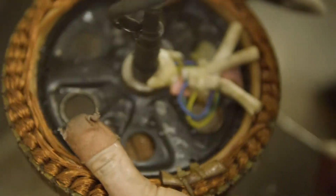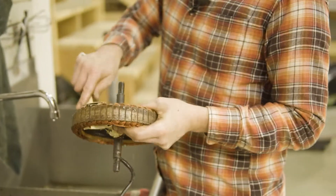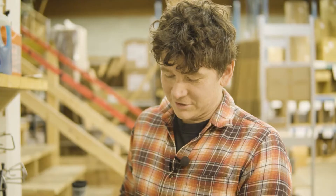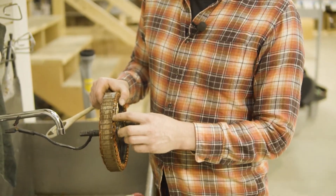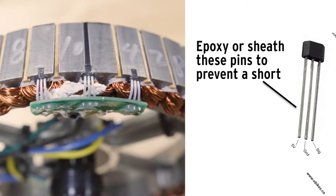Hopefully once we clean the water and rust out, all three will work. One of the most common unnecessary jobs people do is replace the hall sensors on a water-damaged motor because the halls weren't working when it was wet. First just give it a chance — thoroughly dry it, and if the hall then toggles there's no need to switch it. The electronics aren't harmed at all. What you want to do to prevent them from being vulnerable to water again is really seal up all around the exposed wires of the hall board, so if water comes in in the future it's not at risk of causing an electrical bridge between the ground, the 5V, and the signal lines.